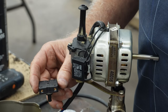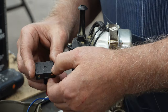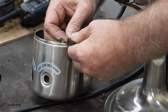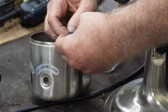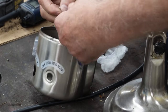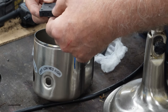It shows that the blue wire... the black wire is on the L, and the L is right here on this. So let's find the black wire — that's this one right here. I don't know if this will work, but we'll try it. I don't even know why I'm putting this old fan back together; it's not really worth it. That isn't going in there, so I'm going to have to get something to help push that in. Let's see if I can get another one in. The white wire is on two — this is two right here.